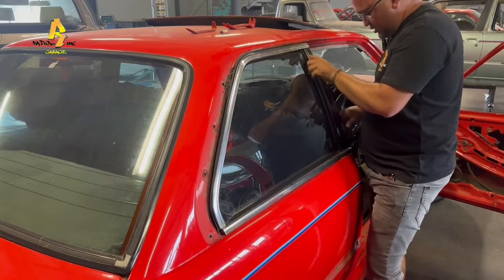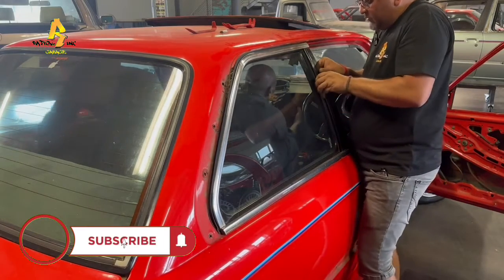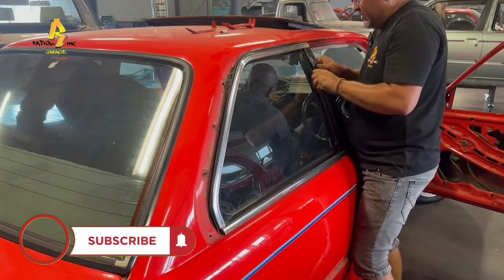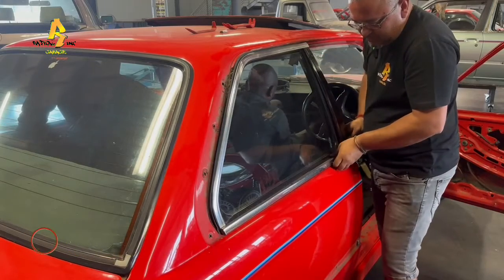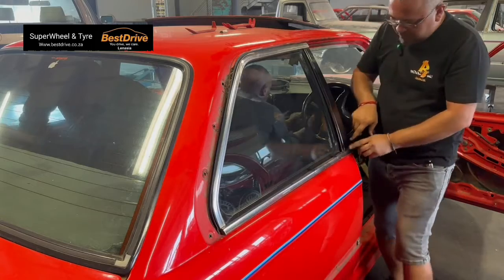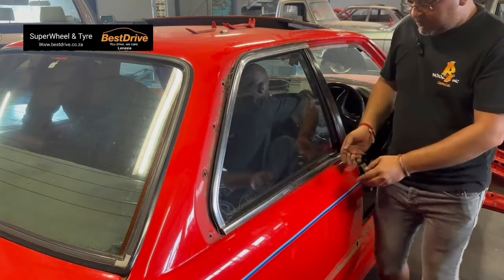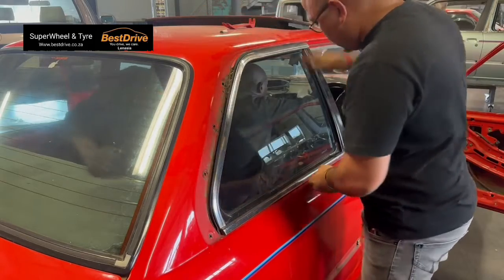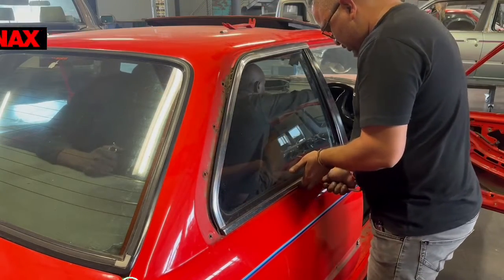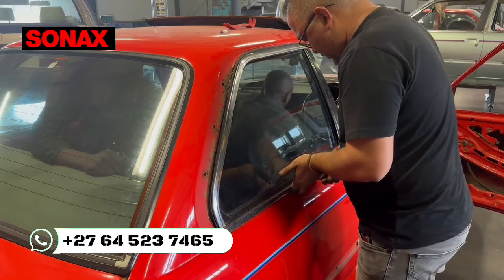Okay, I'm just working here a bit higher. Okay, so I've got the studs out from the body, right? And let's start pulling the bottom out first. So you won't be able to split these two up here. There are two pop rivets running behind here, so I'm going to come with a thinner hook and lift up on here.